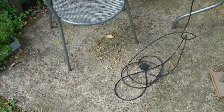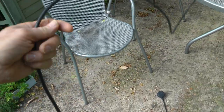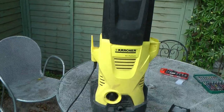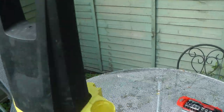Turned it on — the mains fuse has been checked. If yours doesn't work, the first thing you need to do is check the cable, make sure no one's trod on it, driven over it, cut it, frayed it, yanked it. I'm not seeing any obvious signs of cable fraying or damage. Put the hose on, put the lance on, put the pressure on — just not playing ball. Not a peep.